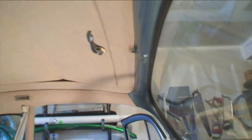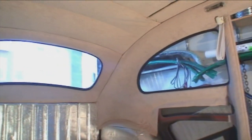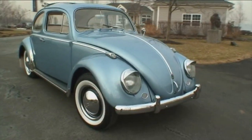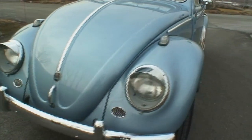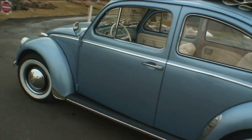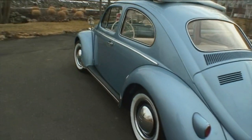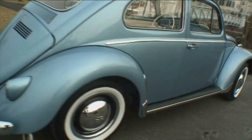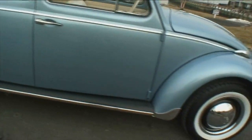This is the end of the headliner installation — we have all our windows in and it looks really nice. There are a couple of wrinkles in the headliner that we can continue to work on, but for the most part it's very presentable. Here we are with our completed 1961 ragtop Beetle. I feel our headliner came out excellent. The TMI material, as I stated before, is for the restorer who is on a budget. They also sell the vinyl material which is cheaper than the mohair. Just keep in mind that with TMI, some areas of the headliner might be a little off with some of the measurements.